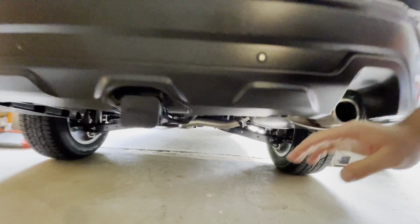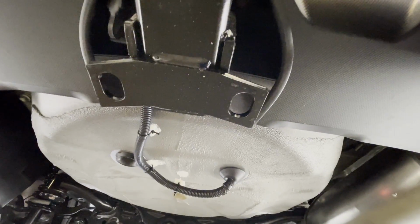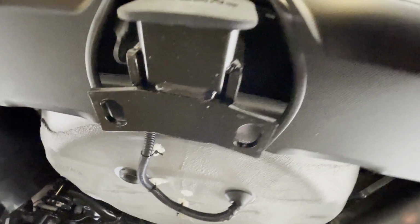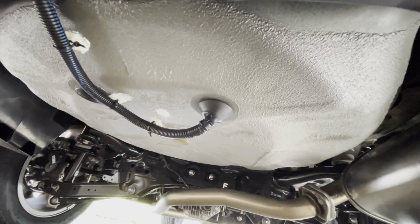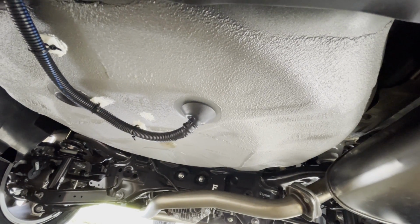So far I've only encountered one issue. That has to do with the wiring harness and where it comes out from the car. You see there's those anchors for the zip ties. Those did come loose, they're just little adhesive pads. This surface is rather rough. Also, I probably should have cleaned it a little more than I did when I did the initial install.